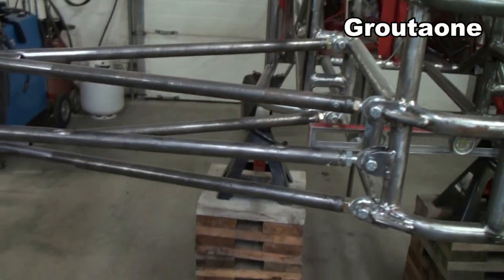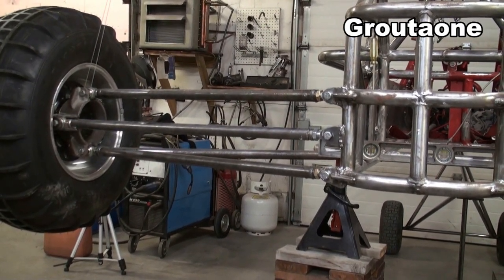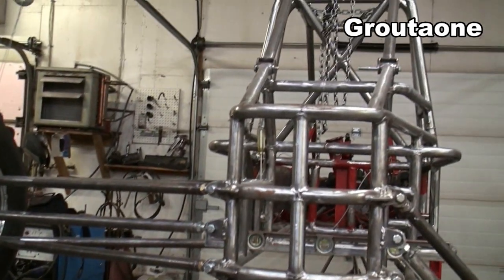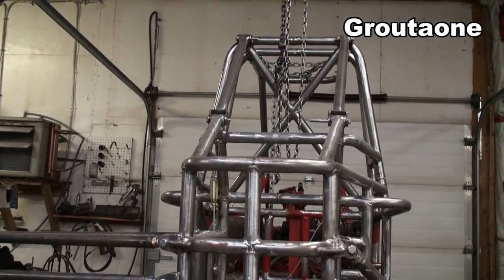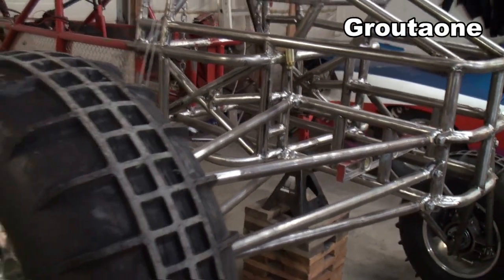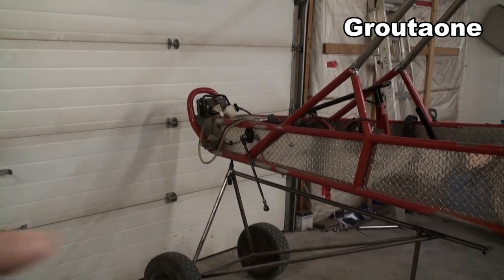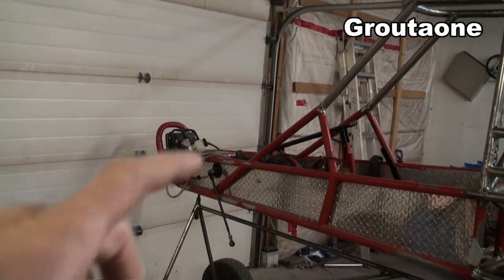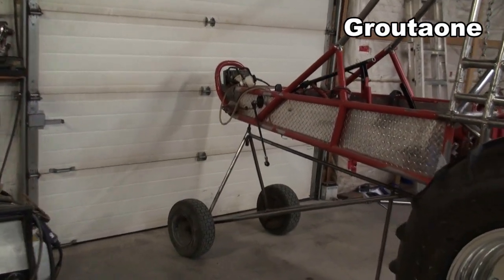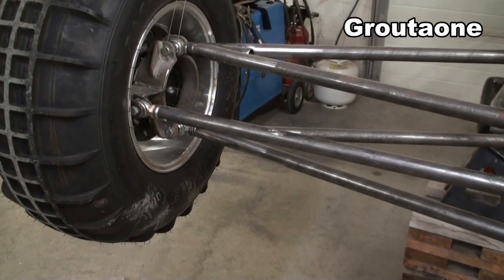That is how I pulled this off. Some things I want to show you yet: what I'm going to do with this lower A-arm — it's going to get some extensive bracing to hold the load of that shock — and I've got to build some elaborate stuff up here for the shock mount also. The back of this machine is actually going to look quite a bit different as I progress through this project. Out in the front it's looking pretty barren, but the same kind of thing is going to happen up there — a lot of structure to support the shock, and then the long A-arms and front tires. The front is going to look very much like the back, with the exception that instead of a stabilizer link, it's going to be a tie rod instead — same kind of idea.